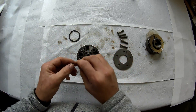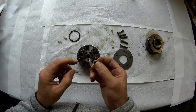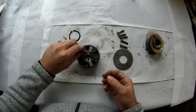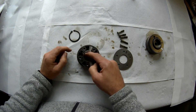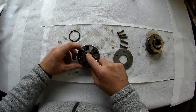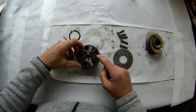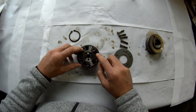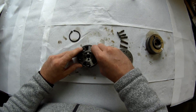The spring is on top, this plastic piece is on here, and that will make sure the oil passage is better — that's what it's for. You can see there is also an oil passage here, so these holes are in connection with this passage too — it is a sort of return. So this one is now locked — this is how it should be, there is not really any play in it. So how does it work: oil pressure comes in the channel in between here, that will press on the bottom side of the pin, and then it can be adjusted. But when you have a cold start, it should be locked in this place.